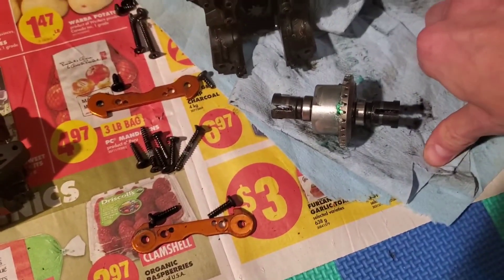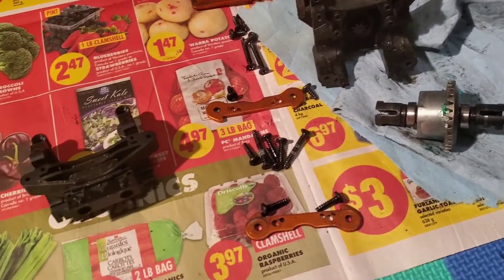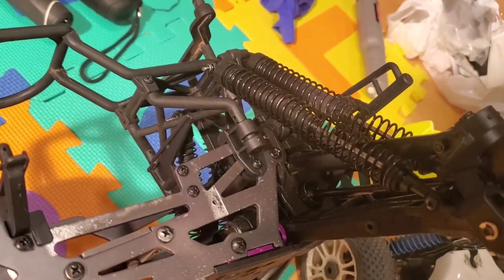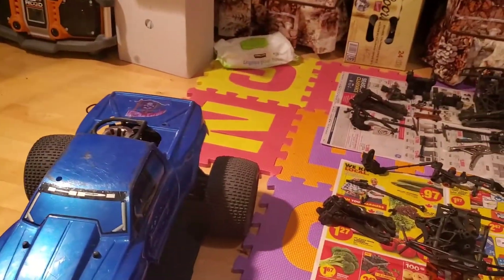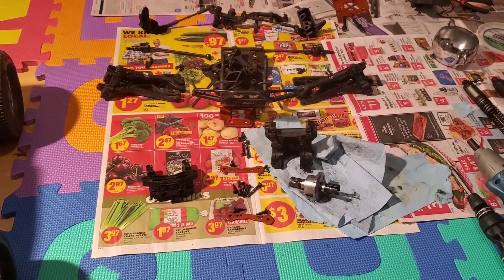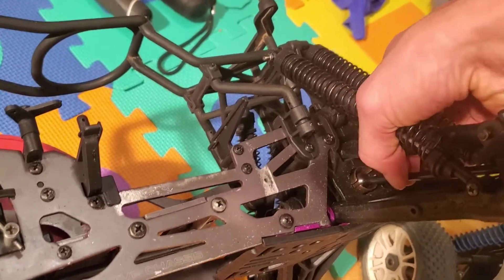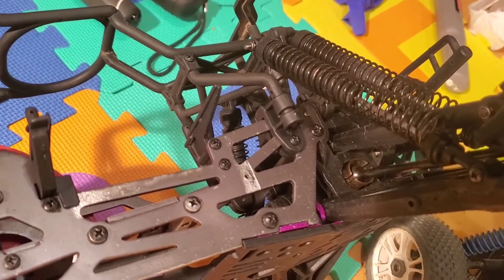That can basically chew the teeth right off and cause irregular wear. These are quite costly — on a Savage, the forged heavy-duty XL ring and pinion gear is about $90 Canadian to replace. So if you see a bunch of movement like that, the bearing's gone and you might want to walk away. For any significant period running with the rear diff hopping around in the carriers, it's definitely going to have irregular wear and impact longevity.